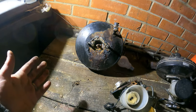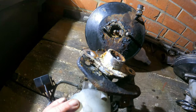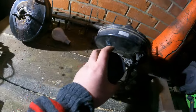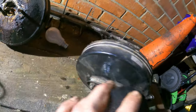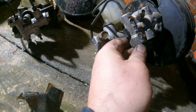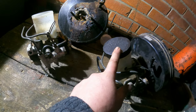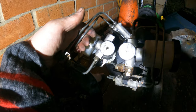If we compare the two — look at the state of that old one. Even at this level the fittings we couldn't remove; the new one is a lot cleaner. And this one looks beefier as well — I think the master cylinder itself is beefier. I wonder if this is actually from a 1.8 which has bigger brakes, because the new one is definitely thicker than the old one.